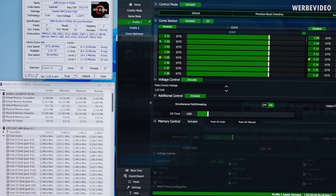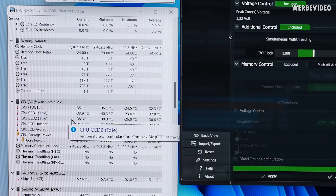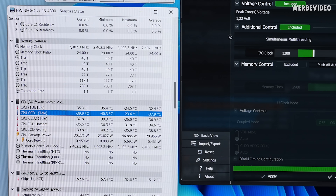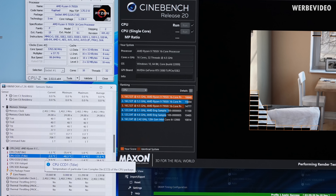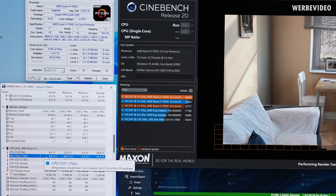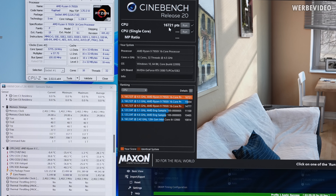Good progress now — closing in on 5.8 GHz. The negative temperature readout seems to work at least within a certain range; my thermometer reads minus 43 and the CPU sensor shows about minus 40, which is perfectly in line. The temperature swings from almost minus 40 to about zero degrees Celsius under load — about a 40-degree delta from idle to load. This should be enough to pass the benchmark at this clock, closing in on 17,000 points in Cinebench R20.